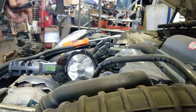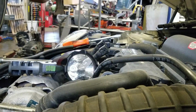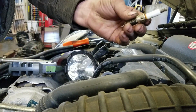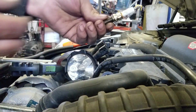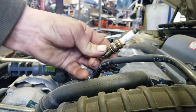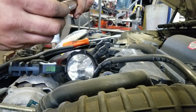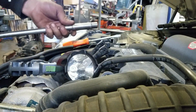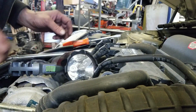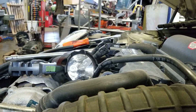All right, let's take our magnet. We'll pull the plugs out, kind of inspect them as they go. They are NGKs. And yeah, they have a 12 point. I don't know, can you see how well that can be seen? Yeah, they're not a hex. They're actually a 12 point socket. So that's what I had to use to get them out. 14 millimeter. We're gonna keep all these in order too, even though there's no problems with this engine. I always just like to look at everything, know if you got a problem in a certain cylinder or not.